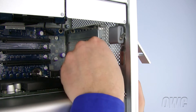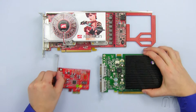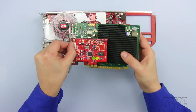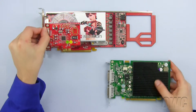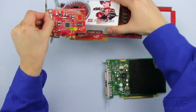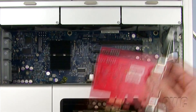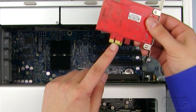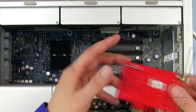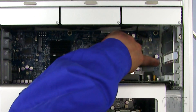Remove the dead plate cover on the PCI Express slot you wish to use. There are many different types of PCI Express cards, in different heights and lengths. What they all have in common is that all the notches match up. Now, line up the notch in the card with the pin in the slot. Also, note the locking tab on the card and the open PCI Express slot.